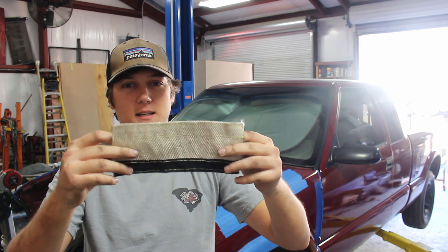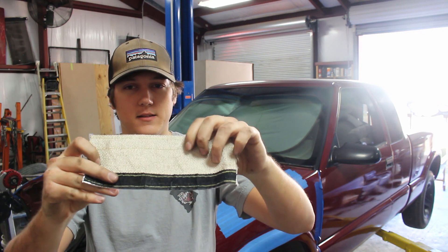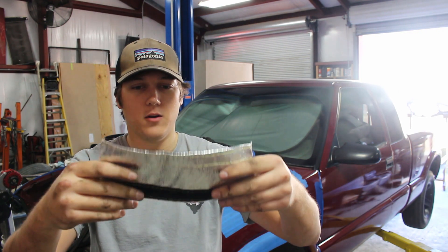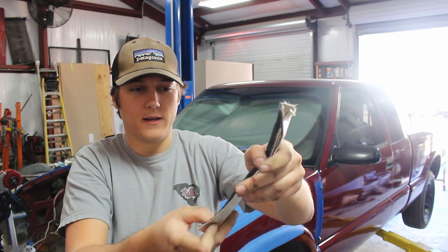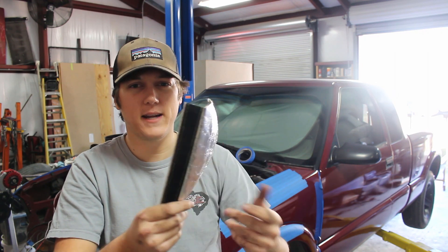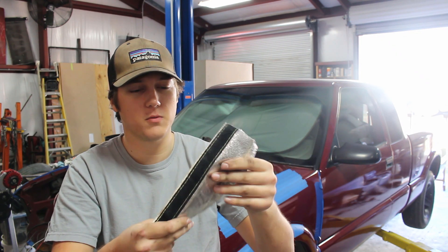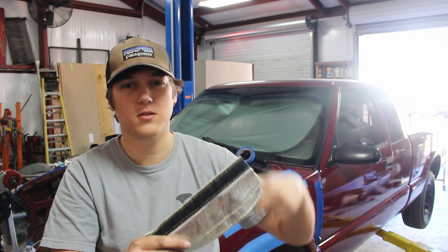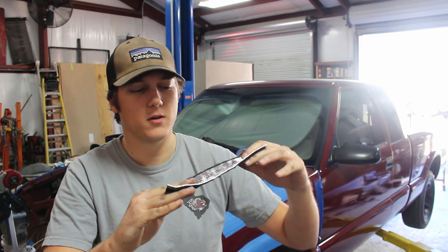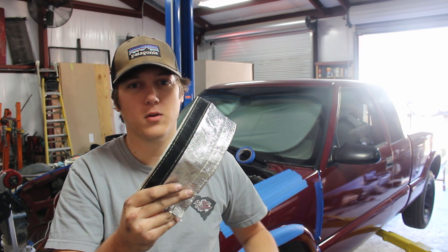The heat shielding I got looks like this — it is flat and came in a big roll. It's got Velcro on both sides. The inside is more of a Kevlar material, like exhaust wrap material, and the outside is the reflective side. All you do is fold it over the Velcro around your wiring and Velcro it down. I didn't get a specific brand — I just found what was on Amazon. It feels pretty good quality and I'll put a link in the description for you guys. I'm not sponsored by anyone; I just picked up what I thought would work best and it suited my needs very well.